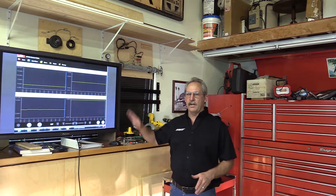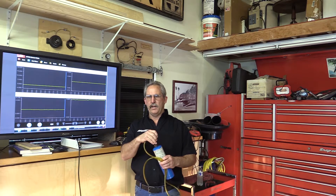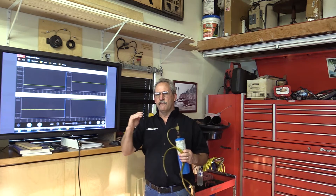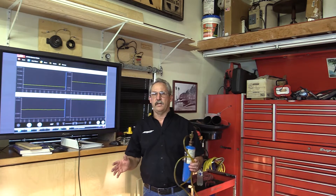So if the OBD system does it, we can too. I'm going to use a scan tool displayed on the screen and propane. I'll add propane, watch my front sensor go rich, my rear sensor go rich, then take away propane and watch my front sensor go lean — counting how long it takes for my rear sensor to go lean. I want to see more than 2 seconds, really more than 10 seconds. Less than 2 seconds means it's bad.